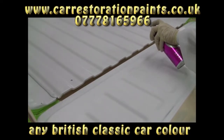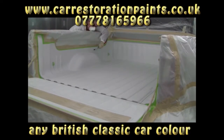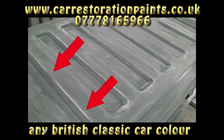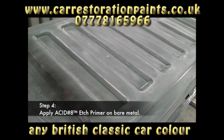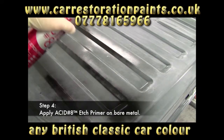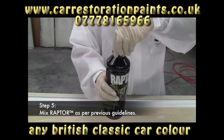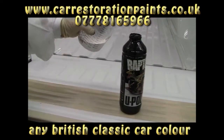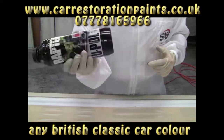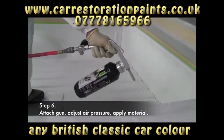Make sure there are no shiny spots when you're finished. Some technicians will also use a nylon bed brush for this application. After sanding, blow out the bed again with the air hose. Raptor should not be sprayed over bare metal, aluminum, or galvanized surfaces, so step four is to apply Acid 8 etch primer directly over any bare metal areas — this provides corrosion protection and a suitable surface for Raptor to bond to. Step five: mix the Raptor as outlined in the previous video. In this demonstration we're using tintable Raptor — 100 milliliters of white basecoat toner is added to each bottle of tintable Raptor base.